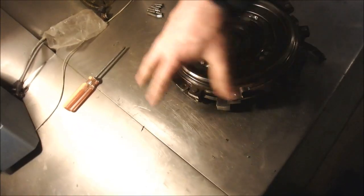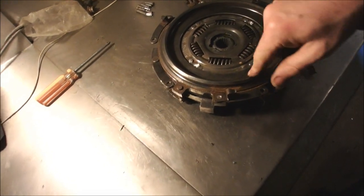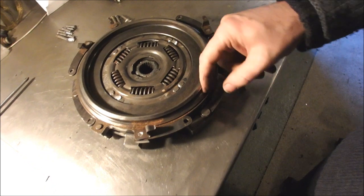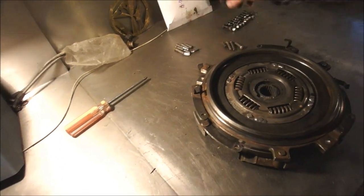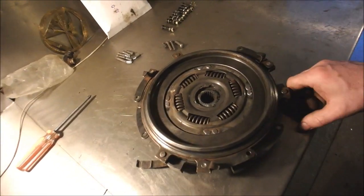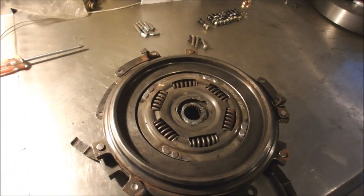So this has the aluminium cage, goes around the outside with the cone spring pressing down on this edge, bolted to the flywheel. And then these little arms fold in. These here get bolted to the aluminium cage where these rivets used to be. Now I'm going to use bolts. May just work. Who knows? Time will tell.